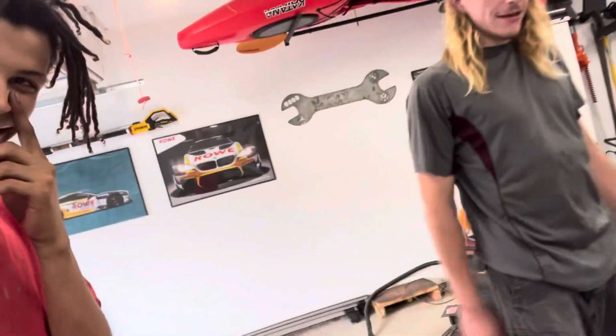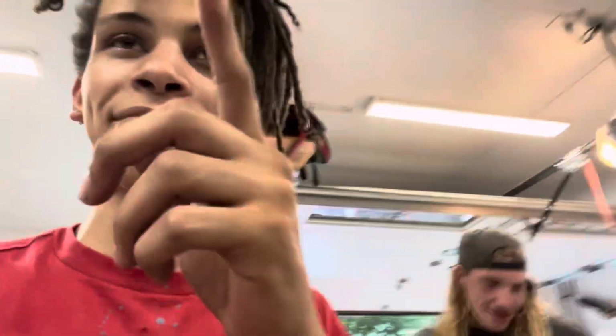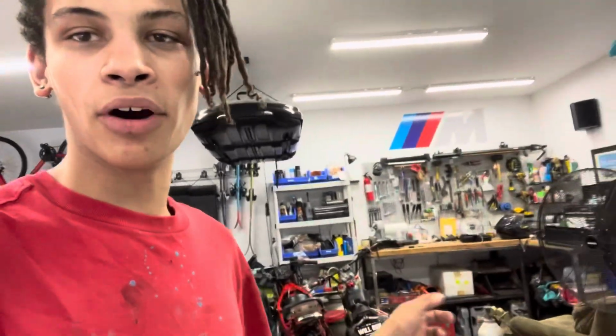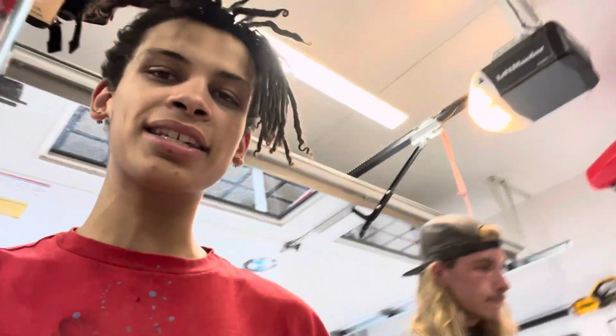Well, thank you for watching. As you saw, we got it to run. It's pretty fast, but it needs a carb badly. So that'll be the next thing we're doing to this, a new carb. Good news is it's running. Bad news is it doesn't like to run still. Yeah, it runs. It's good, but it's not good. Like when we had it on my carburetor, it ran amazing. But on this carburetor, the 28, it's a little bit much for it. And it's not jetted right, and it's not the right air fuel ratio, and Fusco Beast destroyed it, so we're just gonna get a whole new carb, a 26 this time probably, size it down a little bit so it's a little easier to dial in the air fuel ratio, and then it has a little bit more bottom end.